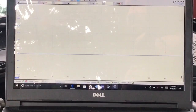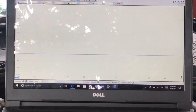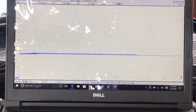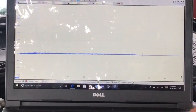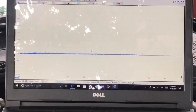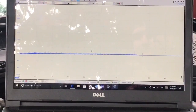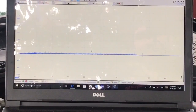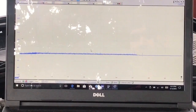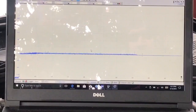As you can see from our frames, we did get a little bit of hash right here — and that's when we're trying to crank it, but it would not start. On these vehicles, even without the cam signal, you can still start the vehicle, and that's where you get the elongated cranks. So I'm going to go get a cam sensor, put it on, and retest it.